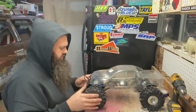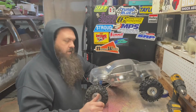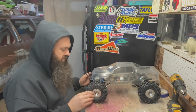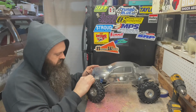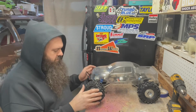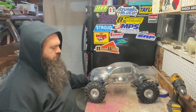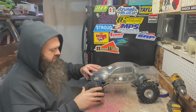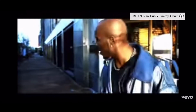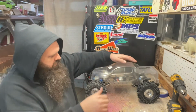Let's see here. It'll sit probably something about like that, which is not centered and I'm fully aware. However, what I do like is the front tires are going to pivot around the front of the body. Obviously, they need clearance, so I'll come up probably right around where the headlights are and cut this flare out a little or something. I'm not 100% sure how much I'll do, but if I set the body back a little bit and kind of almost center up the rear wheels and shove the front real far forward, this actually just ends up pivoting around here. So when it flexes, it'll just be up in here. Up in here, up in here. Obviously, I might go that far, but I do like it right about like that.